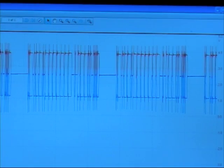The next stage in our investigation was to put an oscilloscope on the CAN network from the BSI to the ABS module. The first waveform shows the CAN lines from the BSI to the ABS module, and you can see from the high and the low CAN that the communications at the BSI are okay.